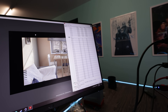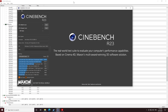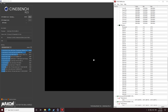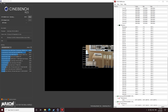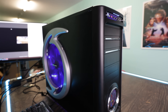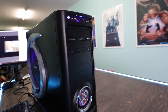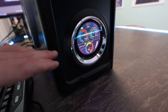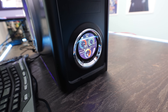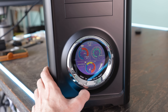2.6 gigahertz out of the box with no tuning on 18 cores, 36 threads. We're running Cinebench R23 for roughly 10 minutes to quickly test stability and temperatures, and make sure the motherboard, CPU, RAM, and everything else can hold up. The build was surprisingly pretty easy considering the case was never designed to harbor such beastly hardware — the motherboard and CPU were from the 2015 era but the case is 10 years prior, from 2005. There's a really cool LCD screen at the front that lets you set the time and monitor four different temperatures: CPU, video card, hard drive, and case.